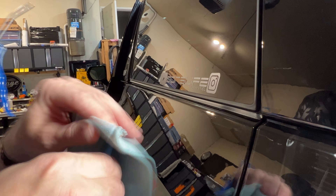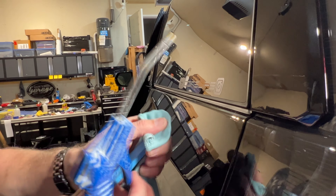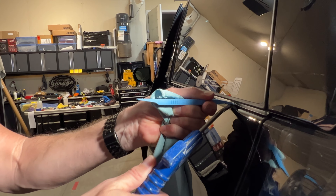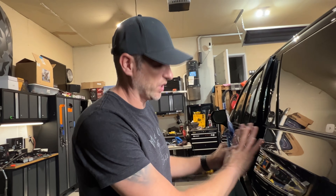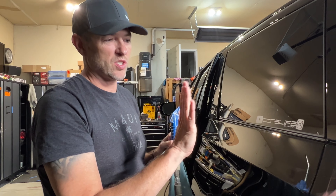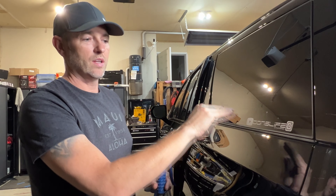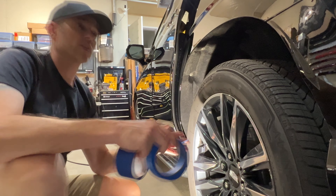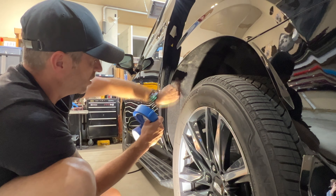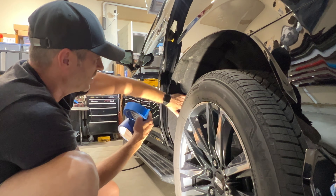Another important and often overlooked step is where you need to tuck underneath weather stripping. I'm not going to be able to remove this window, so I need to peel up the weather stripping so I can use a wrap stick or tuck tool. I'll have a rag soaked in isopropyl alcohol and clean behind it, but that might not be enough. If you have compressed air, that can be very handy to get rid of any sand or particles that might be trapped under there, because there's nothing worse than finishing a panel, doing nice cut lines, tucking under the weather stripping, and finding it's full of dirt — that's where the wrap will fail.